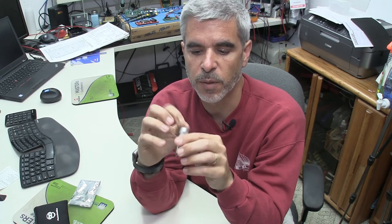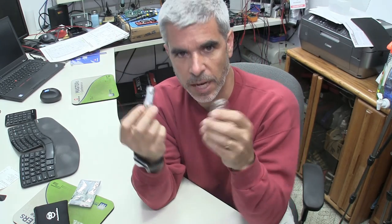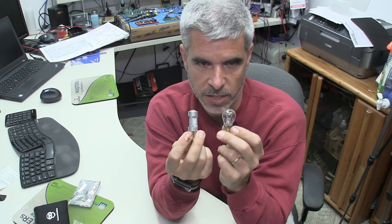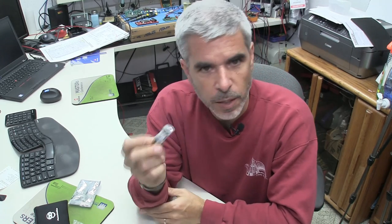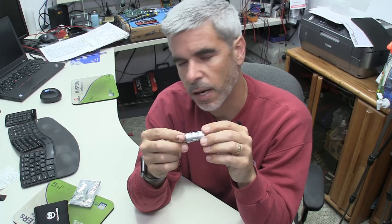Now if the light is going straight out like in the backup light application — with three very bright LEDs shooting straight out through that lens — I really liked the light output. Based on the numbers, that direction was definitely the brightest. Going the other direction, the standard bulb actually did better because the orientation was angled instead of straight back. If your fixture needs all-around light it'll probably do great, but if it needs directional output it can be a little more erratic. I can recommend these — it just depends on your application. Until next time, be blessed!